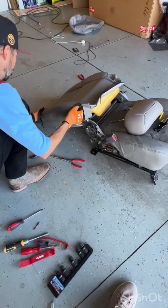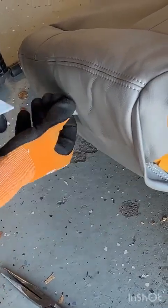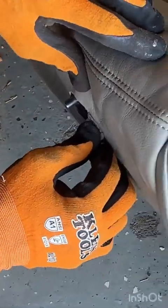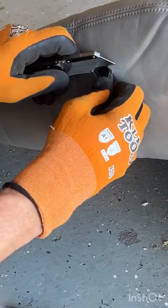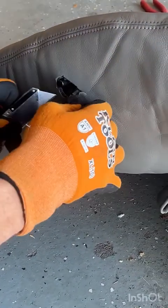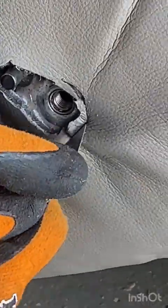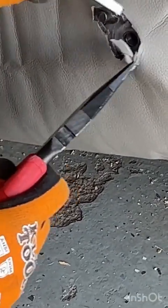So once you've got it all the way down, and you can feel it's tight everywhere, go notch right around this bolt. Below this bolt is the hole for where your armrest goes back in. So find your way over to where you can see where that plastic washer has been rubbing up against it. You want all of that to be free because you want that plastic making contact with the metal. I like to grab this with short needle nose. There we go.